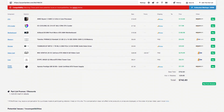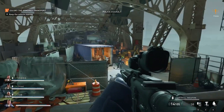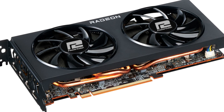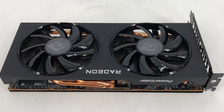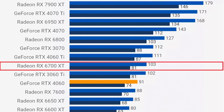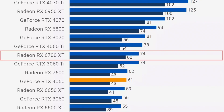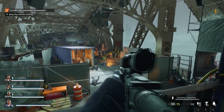The total price for this PC when recording this video is $742, but I do recommend checking the latest prices in the description because it may be a bit more expensive or even cheaper. The better alternative, in my opinion, is going with the RX 6700 XT. This graphics card is not white, so you will have a black component in your system — which is completely fine, since black and white look amazing on a PC build anyway. The reason I believe the 6700 XT is the better option is because it's about 12% faster than the RTX 4060 and has 12GB of VRAM instead of 8GB. On those same tests, the RX 6700 XT at 1080p averaged 103fps instead of 91, and at 1440p it averaged 74fps instead of 61. You can play more comfortably at 1440p, especially on higher settings, since you get 12GB of VRAM — which is going to be important for 1440p on the latest AAA titles.